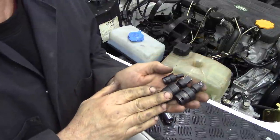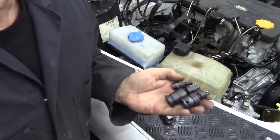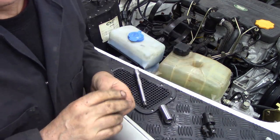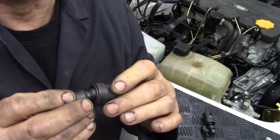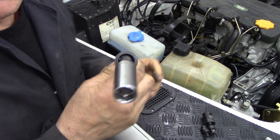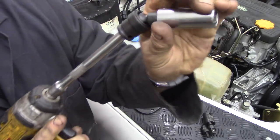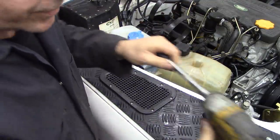I bought a set of three universal joints. They're in quarter, 3/8 and half inch. These were like $30. It's really cheap, but so much stronger than the regular universal joints we're familiar with when you get a tool kit, like a set of sockets. And these are a constant turn, if you see what I mean, which makes it handy. Now, I put 17mm sockets in, and I'll try and include the video or a clip of it when I was underneath. But by using it with your impact, you could get right underneath at a good angle and tighten those bolts up on the bell housing, so that was really good.